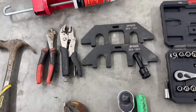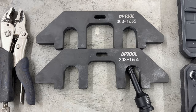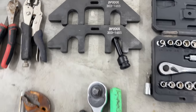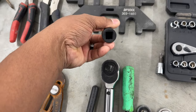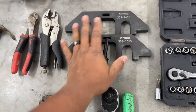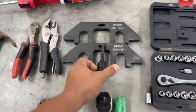This was a specialty tool that I ended up ordering from Amazon. For this year, you will need this part number here, 303-1655, and it also comes with this socket, all going to be linked down in the description. I think it's a 1/2 inch. This is what you're going to be using to lock your cams and to install the new hardware for your cam phasers.